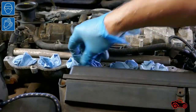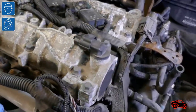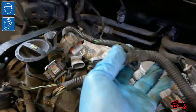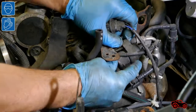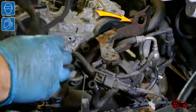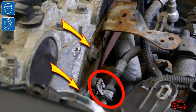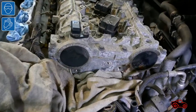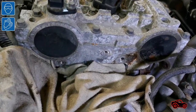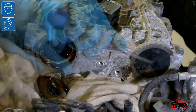Then I plugged the lower intake manifold inlets to protect them from dust and debris. This is the upper section of the engine electrical harness. I disconnected many branches of the engine harness to access the left-hand side of the two camshafts. This bracket was held in place by two bolts. I disconnected the hose bracket and placed a rag to catch some oil that could come out from behind the expansion plugs. I used a narrow wood chisel to remove the two expansion plugs.